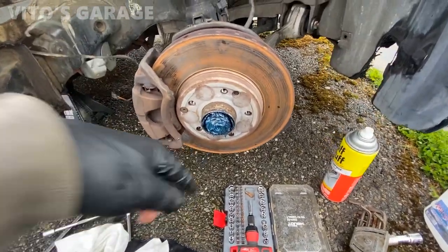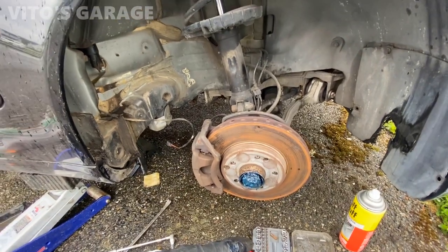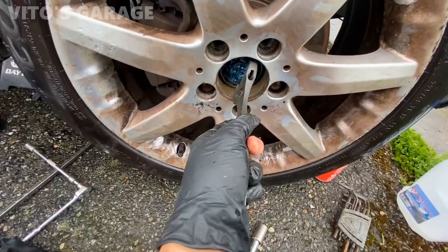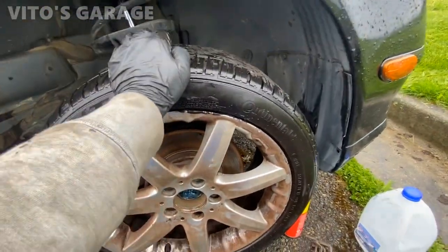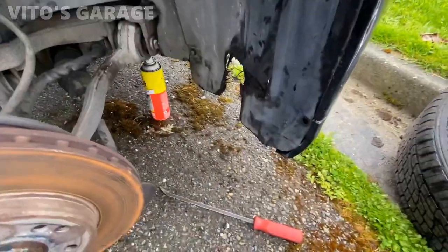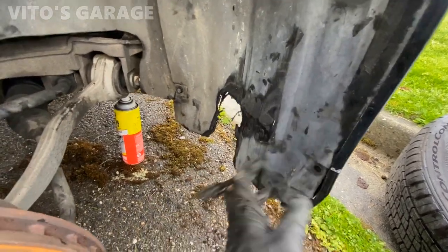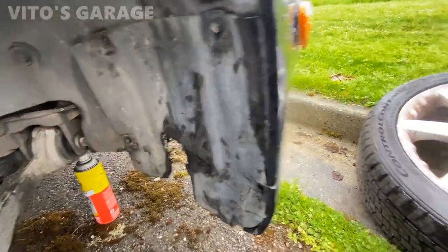I got the cap off and I'm going to adjust this bearing by putting the wheel back on. If you haven't watched my videos on how to adjust the wheel bearings on these amazing machines, the link is going to be up here. I'm going to turn it a little bit, just to the point where the play is gone in the wheel. Now it's gone — awesome. I'm going to take the wheel off and tighten that. The tire was rubbing right here because this panel wasn't connected or installed properly — it was actually coming out. I rearranged it back now, just have to find a bolt for this. It was actually cutting a little bit into the tire on the inside.